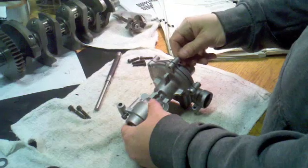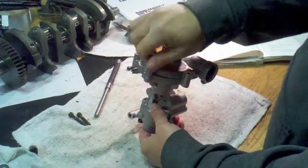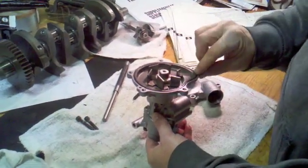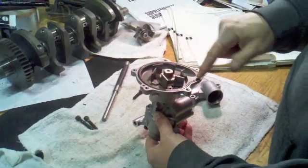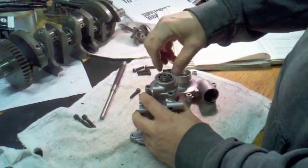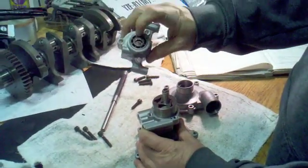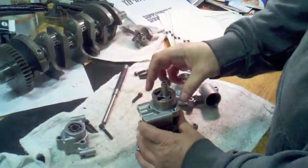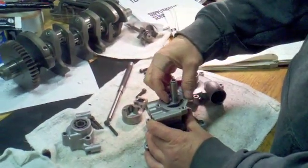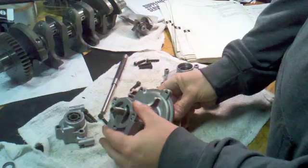I'm really glad that I did. The teardown is really straightforward: you remove the bolts on the water pump side to remove the cover plate. There's an o-ring that sits in a channel in the housing, and then you can see the impeller shaft. You turn the unit over, remove the three screws that hold on the oil pump housing cover — there's a bearing that's press fit in there — and this gives you access to the outer rotor, the inner rotor, and the small pin that goes through the impeller shaft, at which point you can remove the impeller shaft from the unit.